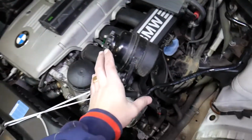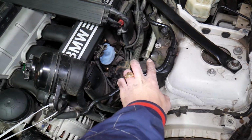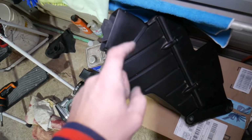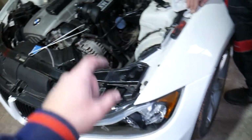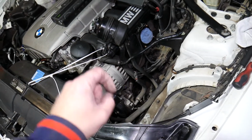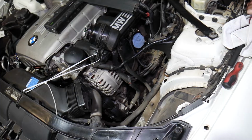This is the power steering fluid reservoir. There are two nuts that we need to remove, and we just barely flipped it on the side a little bit. Here we remove the air filter box. If you want to see the video for the air filter box removal, it will be on our channel. Search for BMW E90 air filter box removal. We'll try to put the link in the description of the video below.